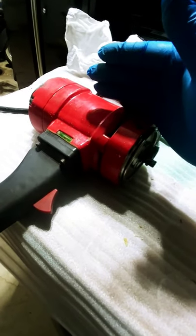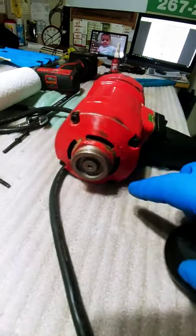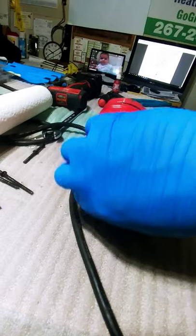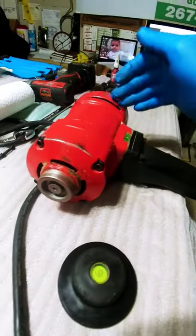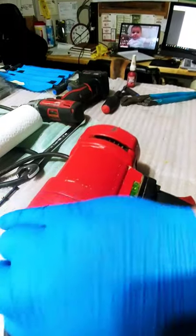You can also check the brushes. Behind here, you can take this cap off — it just spins right off. There's a little vent back here that covers the vent holes, so you want to clean that up. As soon as you take these four hex heads off, that'll pop off, and on the other side you'll see the brushes coming in from each side — they're spring-loaded. I pulled this out from the front, and the entire fan and arbor comes out, giving you an opportunity to clean up the inside — debris from the brushes builds up. I just blow that off with air.